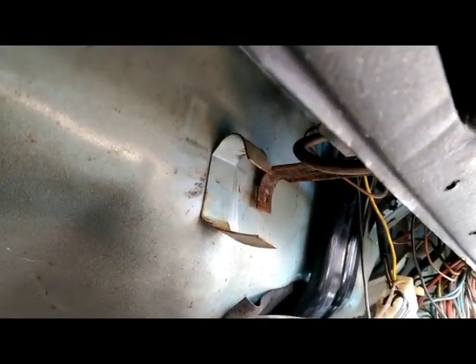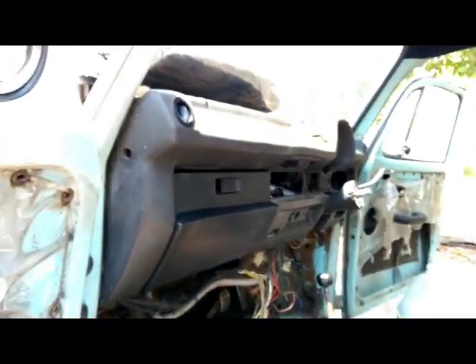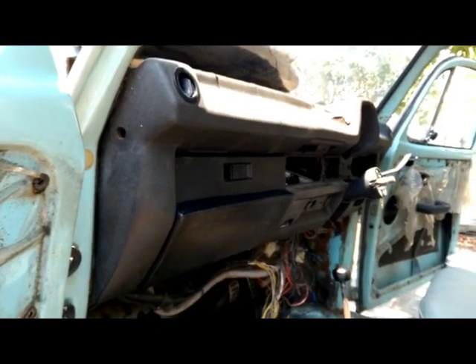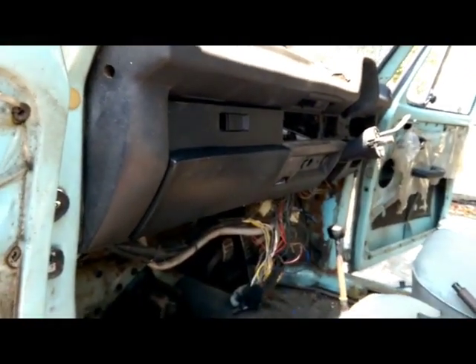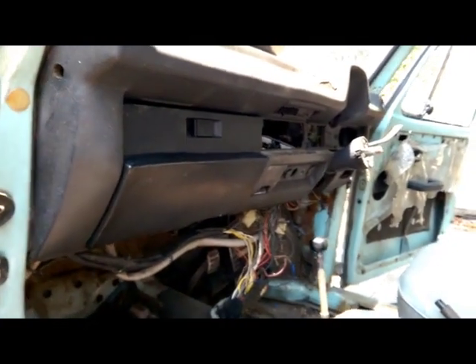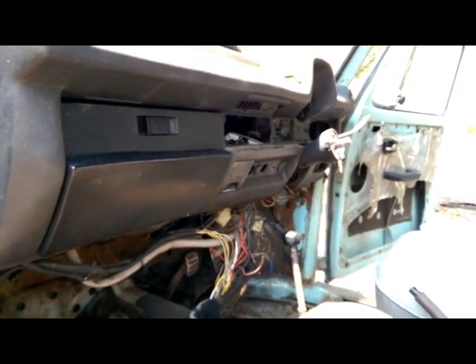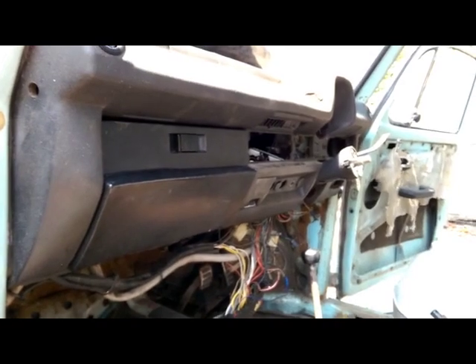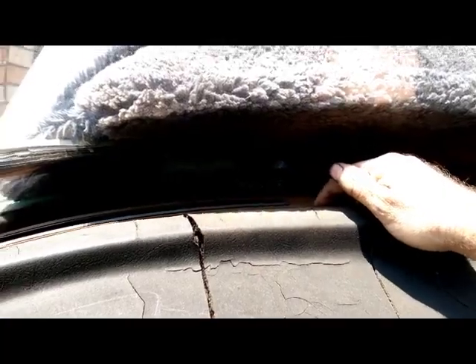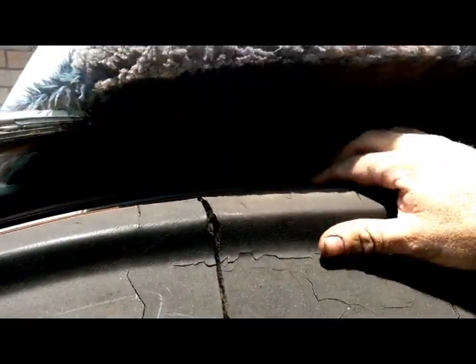So now that that bracket's free, the dash can be removed. I've re-engaged all the clips along the top so it would be as per factory spec. The dashboard will need to be slid towards the rear of the car, but be very delicate when doing that and don't move it very far as the wiring loom is normally attached to the back of the dashboard in a couple of spots. One other step before removing it: these plastic dash vents — which are only on the '74 and newer super beetles — need disengaging from the metal panel; on the end they just have a bit of a lip around them.